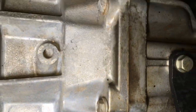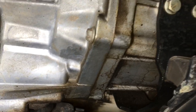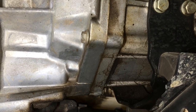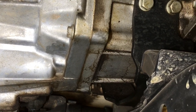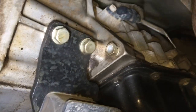That's transfer case oil, which means it's coming out of the front seal of the transfer case. To get to it you undo these bolts and the two separate. The front seal probably has the slightest weep - it all goes to the bottom and comes out there. It looks worse than what it is. It's going to be quite a large job to remove the transfer case and replace that seal. Very rare and not usually a bad leak, but something to be considered. I'll talk to the client about what we're going to do with that.